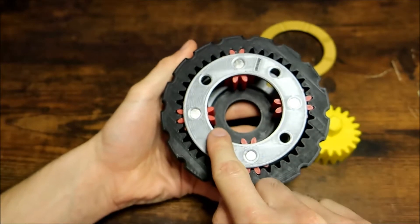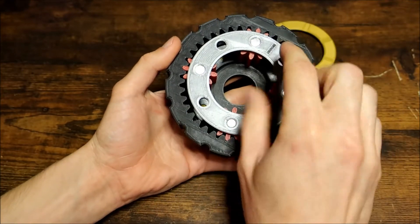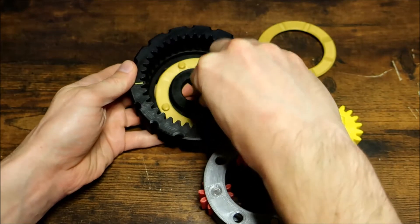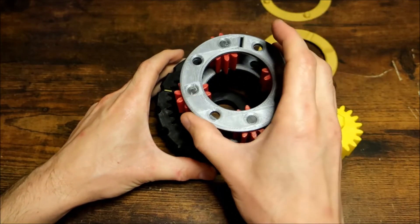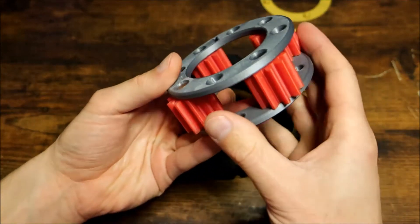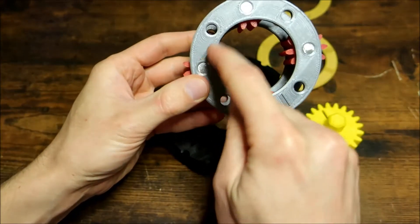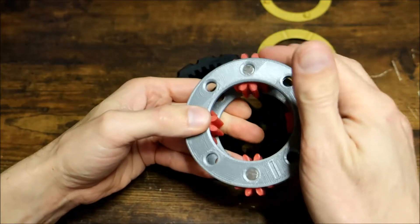We also have this piece right here, which is known as the carrier assembly. The carrier is going to have — you can see if I rotate this — the smaller pinion gears. The carrier is going to contain the planetary pinion gears. And even though they are all located on the carrier assembly, they're not physically going to be rigidly held in place, meaning they can basically idle and spin freely on each one of these little pinion shafts on the carrier assembly. So even though this rotates as one, it's important to note that each one of these planetary pinions can actually rotate independently from each other.